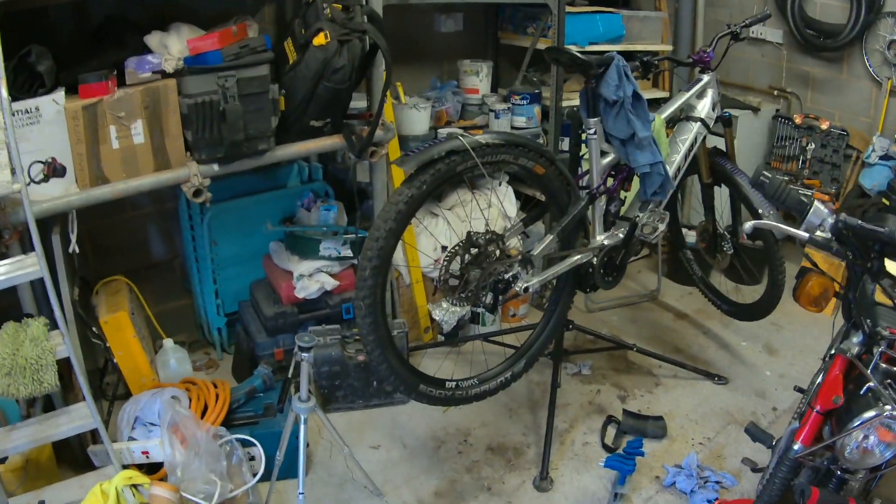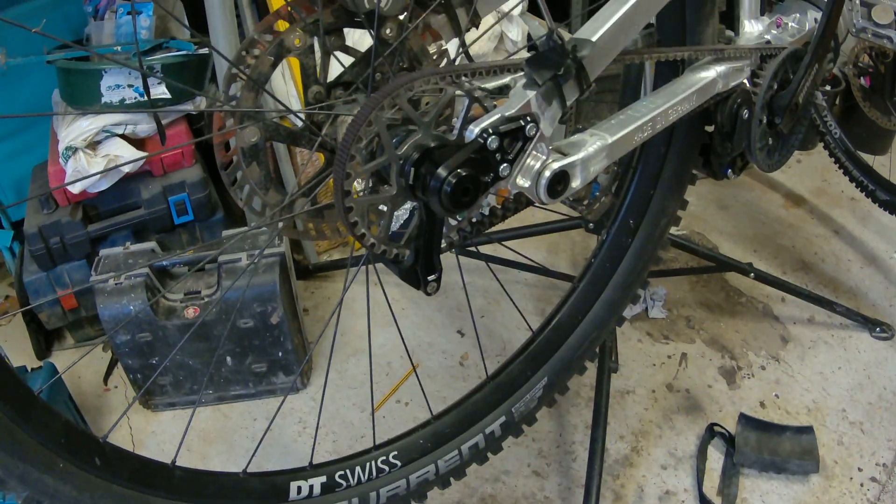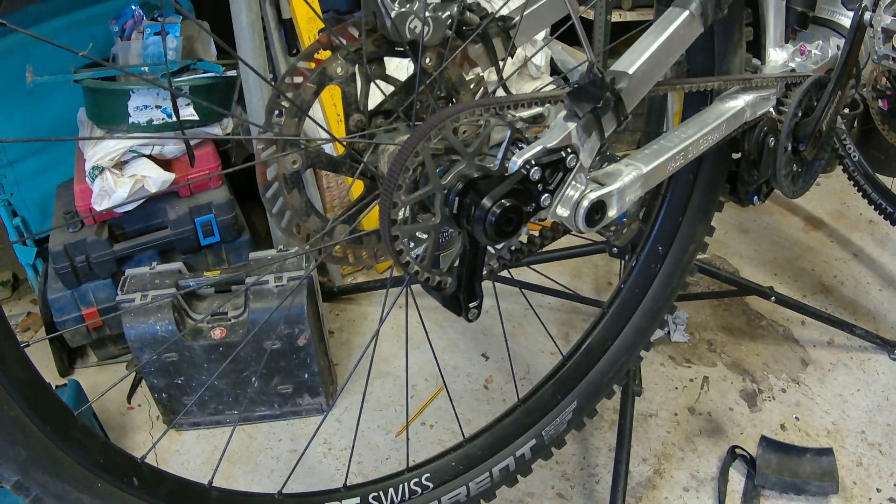I hope that was of some use to somebody, somewhere in the world. Very simple process: old pulley off, had to use something to work against the leverage of taking the securing center bit off — used the plastic handle of a wire crimper. Took a spacer off because the new CDX pulley was a little bit thicker, so dropped a spacer and everything's fine, running sweet, snubber on. Happy days boys and girls! Until the next random Tech Tuesday — like, subscribe, drop a comment — in a bit, peeps.